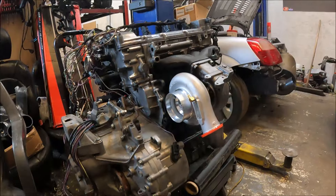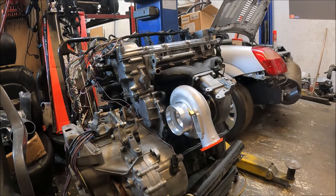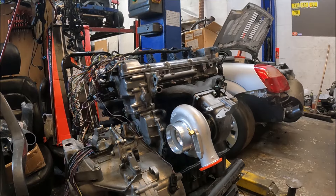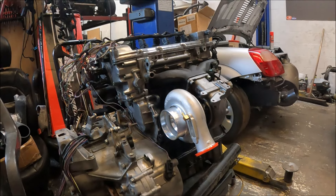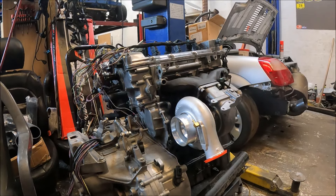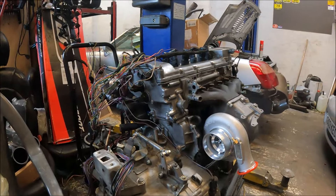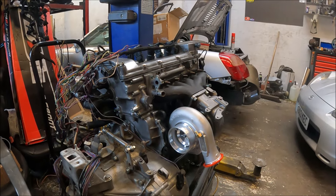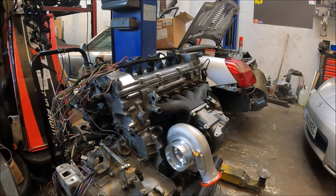Still, there's no point overdoing it for nothing. The basics of it: the bigger the engine, the bigger the turbine side; the higher the boost, the bigger the turbine side. Although this is a relatively large-capacity engine, it's fairly common to have a GTX35-size turbine on it. This is basically a stock-internals car with a little boost tickled in — it's going to feel OEM, just with another 120 horsepower or so. Realistically, people have been pushing something that flows about the same as an 8cm with a GTX30 turbine wheel to 500 horsepower anyway, so this will still have an easy life with no top-end restriction.